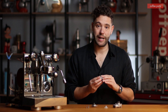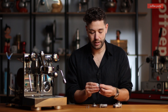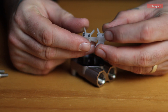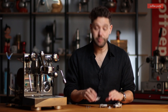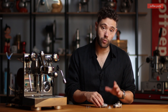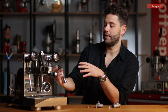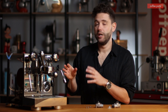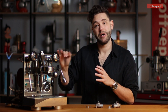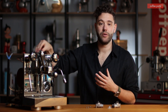One thing to note is different brands have slightly different forms of impellers. If you look closely, this one has bigger magnets, this one has smaller, and the gaps are slightly different. So it's important to buy the right ones when servicing your machine. Most machines have a touch pad where you've programmed it in, and most of the time the flow meter sits just behind the group head.